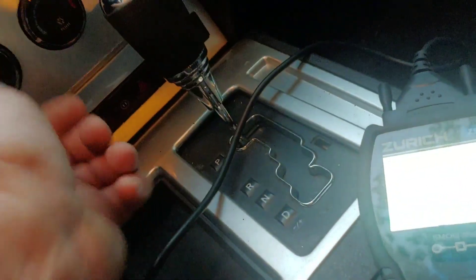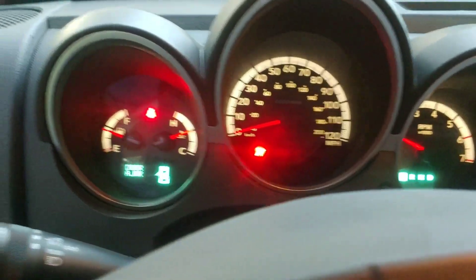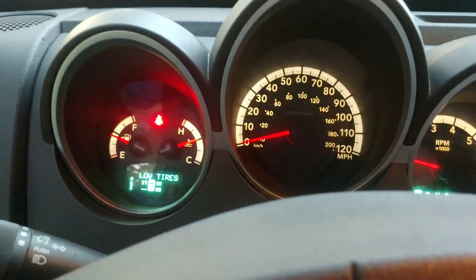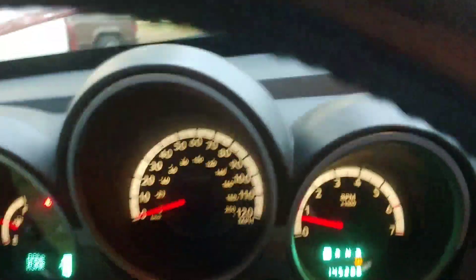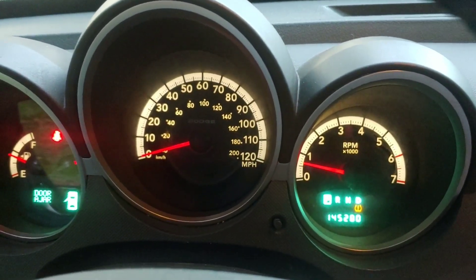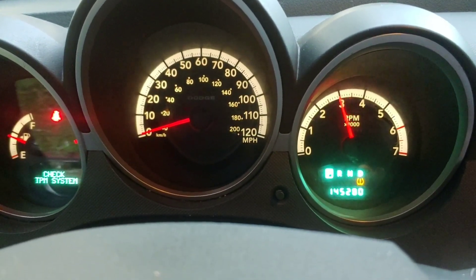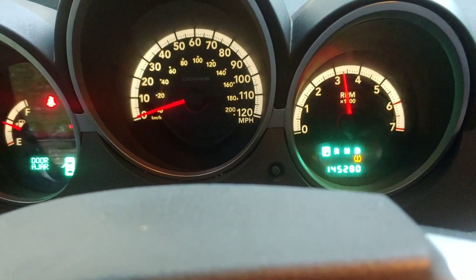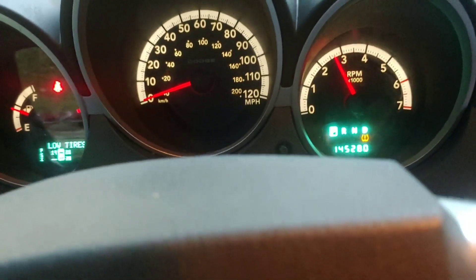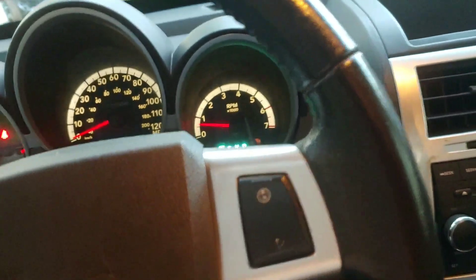Let me turn this fan off — you'll kill it, you'll have to restart it. Whoa, whoa, whoa! Finally starts. I think the battery is kind of a goner. Alright, thanks for watching. Now the check engine light is not flashing. It doesn't like to return from idle — I'm going to give it a bunch of fuel, there it is again, and let off of it, and it's just slow to return. I'm going to clean the throttle body and see if that helps.